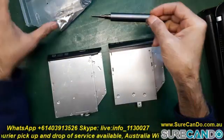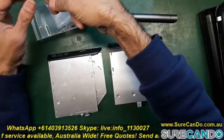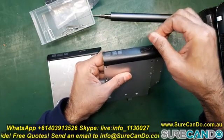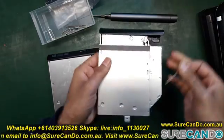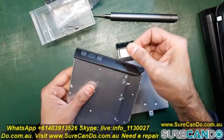If you haven't already ejected the DVD drive, you'll need a long pin like a needle. There's a little pin hole which you'll need to gently push into at the right angle, and the tray will come out. You'll need to do this to remove the heads.